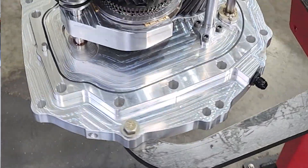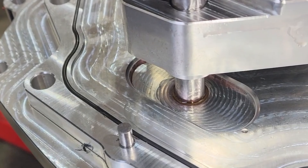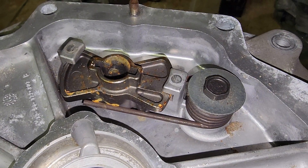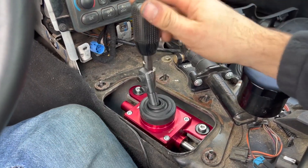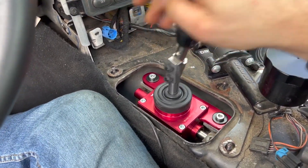One thing to note about the Corvette: if you're a T56 guy, you'll see there's no bow tie on the front of this plate. The factory bow tie is the detent — it rocks back and forth with a spring on it. They're really bad to wear on the plate and cause shifting issues over time, so we've omitted that. We've had a spring made to go in our shifter that accommodates for the lack of a detent in those applications. So they will have to have a shifter with a strong return-to-center spring.